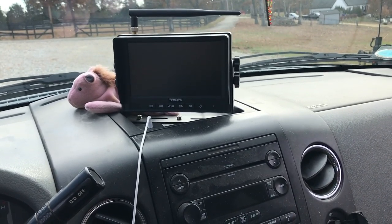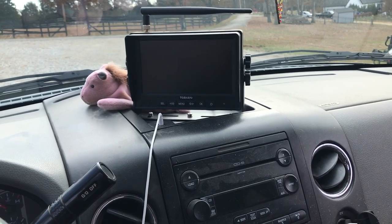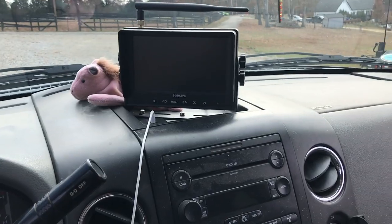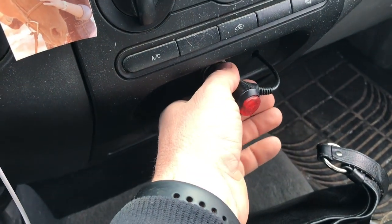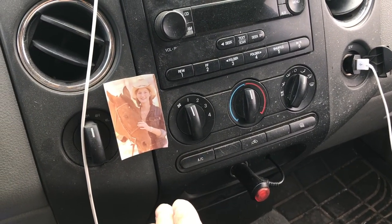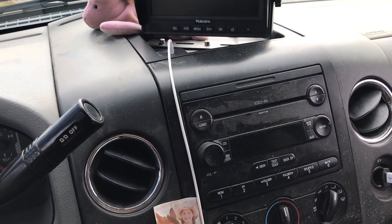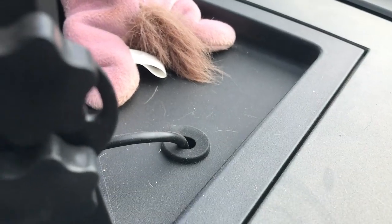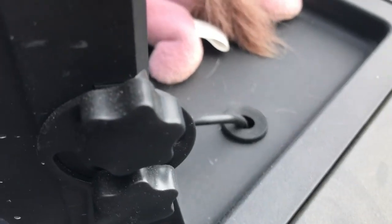As I mentioned, this camera is usually for putting on the back of a trailer or a truck so you can see behind it. But we decided to do something a little different — we wanted to mount the camera inside of her horse trailer so my wife can keep an eye on her horses while she's driving. As you can see, this is a seven inch monitor here. It was really easy to install and it comes with a little cigarette lighter plug. I wanted to set it up in such a way that still looked neat and tidy, rather than having all this wiring run down over the dash. What I did was remove the little rubber cover here, then took a drill bit and drilled a hole through the plastic piece. The Halo View monitor actually has a rubber grommet already installed on the wiring, which I like — so it looks clean. It's a good clean install, it looks like it was made for it.